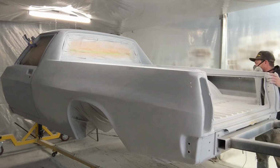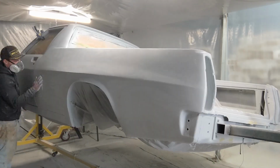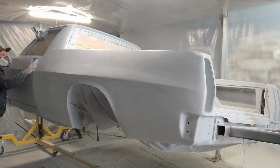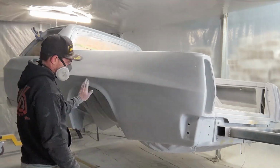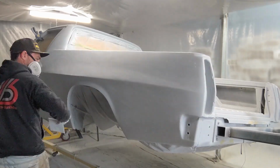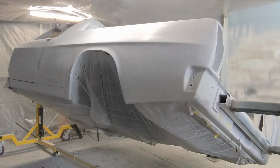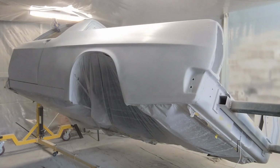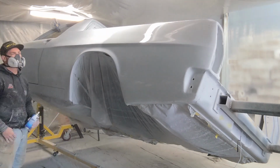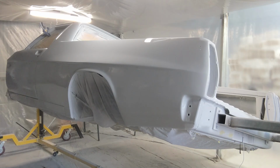That was something I was deliberating about last time, and I went straight for the high build. However, it was definitely worth it. I went to Perro's in Bendigo and got their polyester surfacer. I can't remember the brand, but it was great. I applied about three thick coats and it built up really, really fast. Then I started sanding it back and used the guide coat, and all those little undulations that I was really chasing and having a hard time with were just feathered out. So my advice from using all three methods is definitely go the body filler, then the polyester surfacer. I was told to do that and I didn't, and I regretted it. So it's definitely worth putting that into your process.